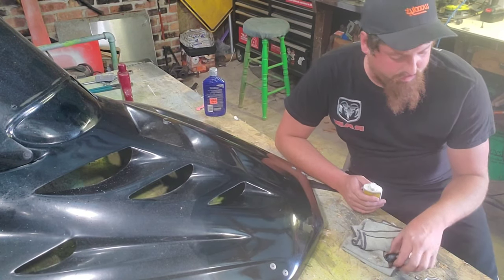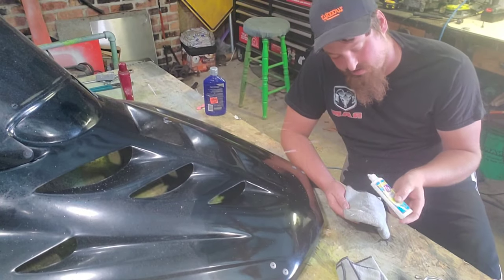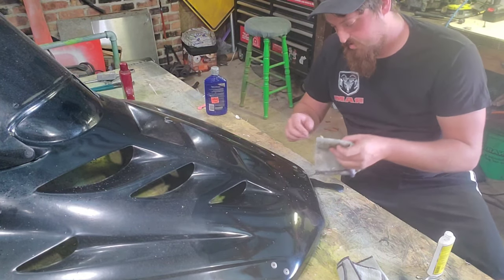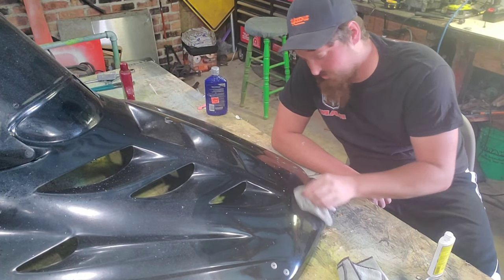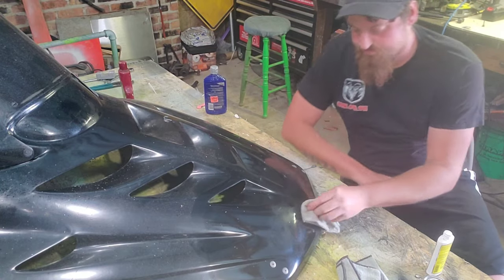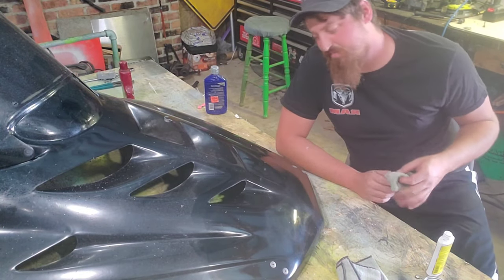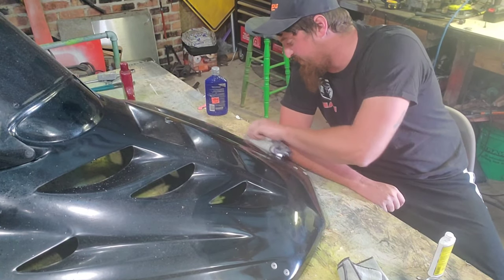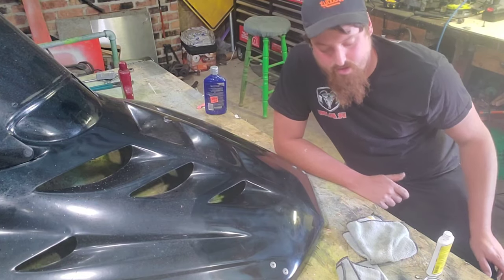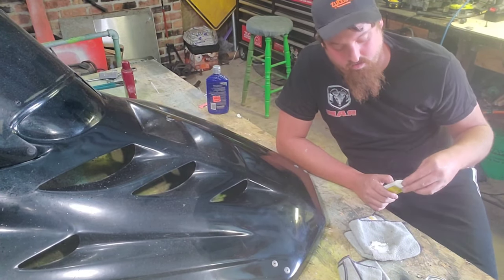We're going to try a little bit of the Wizards Turbo Cut. I'm not sponsored by any of these products — just different things I've used over the years, sometimes because they were on sale, sometimes because they actually work. The Turbo Cut is a nice medium grit and works really well on scratches. Same kind of principle — put it on, let it dry, come back once it's got a nice haze to it, then give it a buff. I'm really trying not to have to get the buffing wheel out on this project. If you catch an edge of the hood or a vent, it just eats the paint off — not something I'd suggest on a project like this if you're concerned with how it looks.